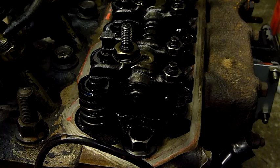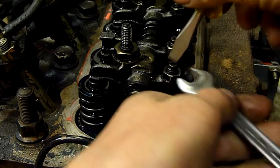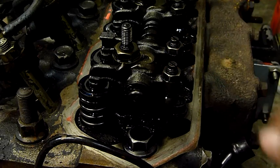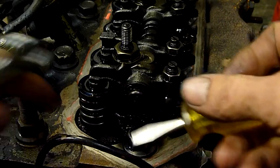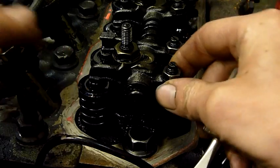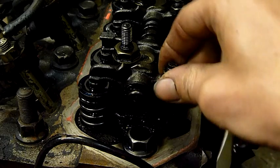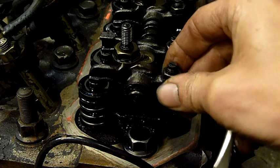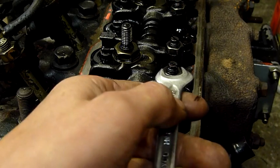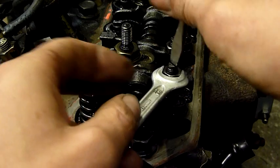So it's a bit of a juggling act. Loosen the nut off — these are quite tight at the moment. The engine is tight at cold in normal position, and that's typical: the valve margin, the head of the valve, will wear into the head and the top of it will gradually come up as the engine wears in and out. They'll just get tighter and tighter until they're not even closing properly — just like the Datsun L18 I was working on, they were so tight you couldn't move the rockers up and down at all. They can move side to side but not so tight you can't move them up and down. So in order to do that, we have to back the screw off a tiny bit.